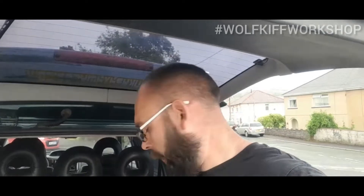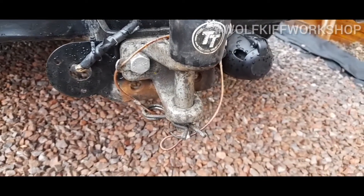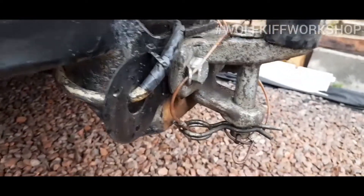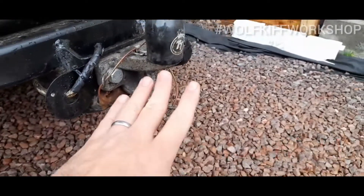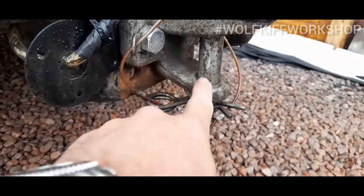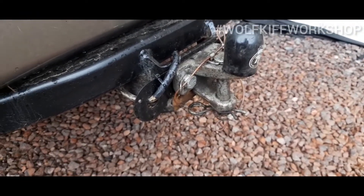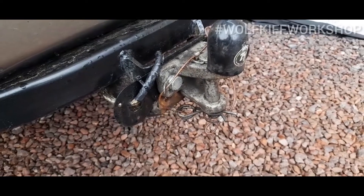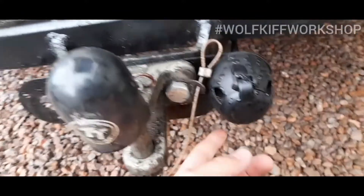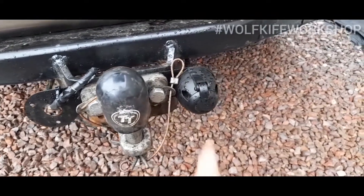Back on the Shogun — today I've got the parts I needed so I'm going to try and finish it off. I put the agricultural heavy-duty tow ball on just to check it out, but the thing is it's on the second set of holes up here, which means the tow ball itself is higher — that's not ideal because trailers will sit angled up when hooked on. Also the bottom part is lower than that, so it's more likely to get caught. I think this tow ball will have to come off until the vehicle is raised. For now I'm putting the original tow ball back on the bottom holes so it's easier to tow with. I also fitted a new towing electrics socket just for the trailer lights, which is the main one, and that's on.